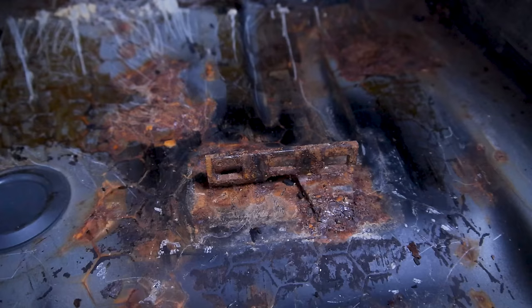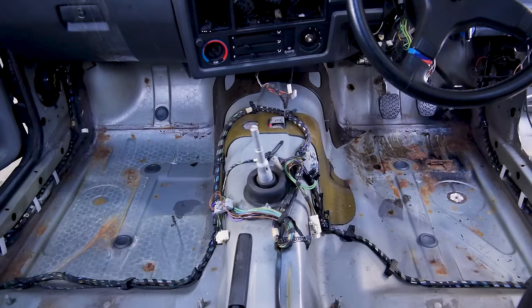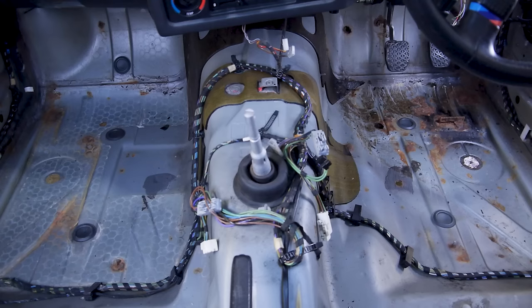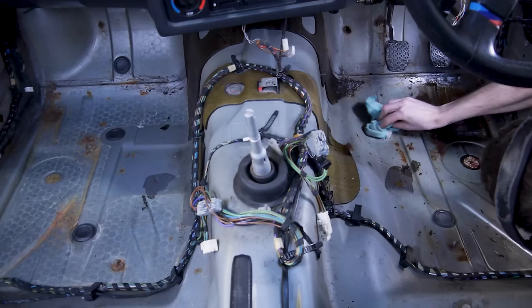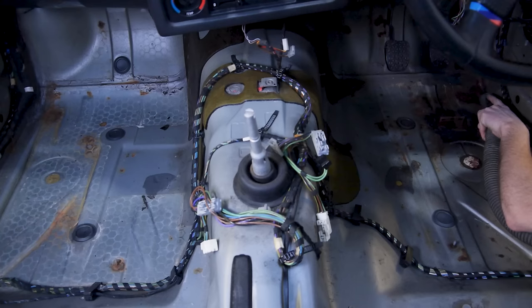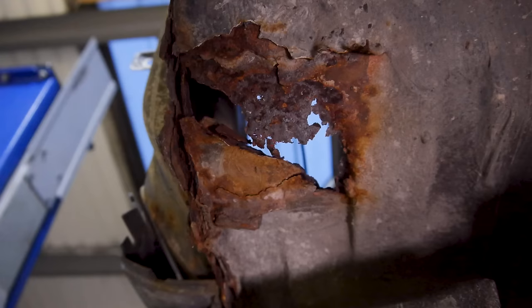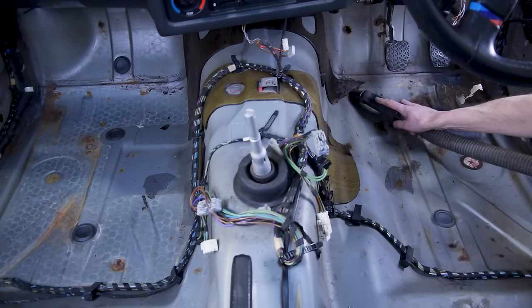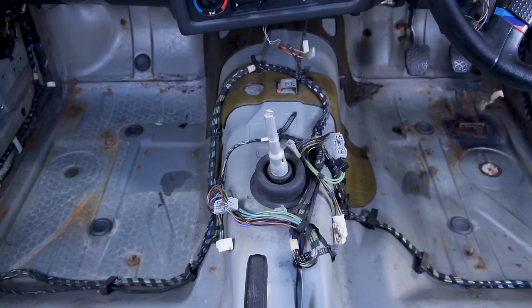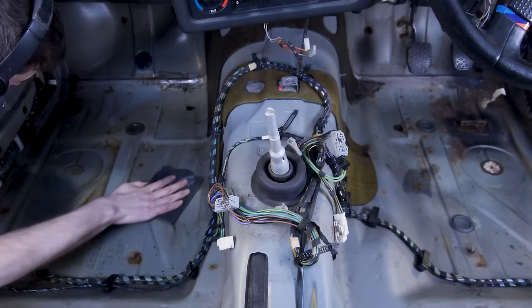Now all the bad vibration damping is off, I've found a few more holes on the right-hand side, but overall it's not looking too bad. These footwells will give me a good chance to get used to the new welder on thin sheet metal. I'm using solvent and a Scotch-Brite pad to loosen the old glue and rust stains, making it much easier to see where the real rust is. As I was cleaning up the final bits of vibration dampening, I accidentally pushed the vacuum hose through the jacking point — the metal is that weak. E30 Garage Norway have these sections pre-made; I'll be needing two of them, one for each side. The smaller holes I'll be cutting and butting with sheet metal. The left-hand side is in much better condition than the right — the front corner needs doing but I can't poke through from this side, at least.